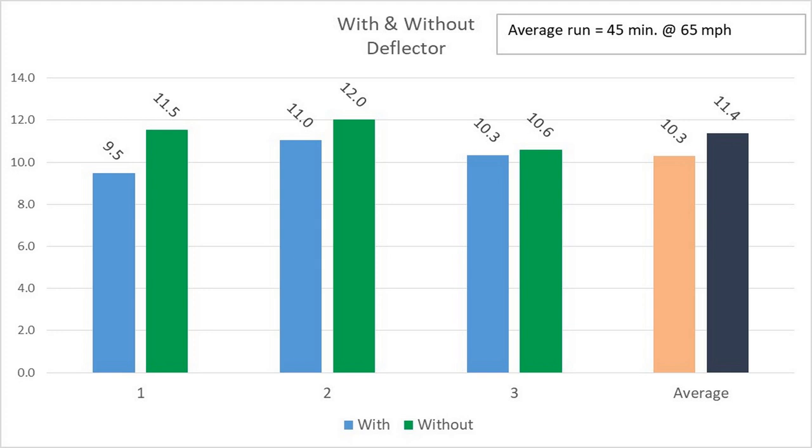I'm recording this data at 1 second intervals. So I pulled out all of the accelerating, decelerating, idling, anything that wasn't a steady 65 miles an hour, just to make sure that we are comparing apples with apples. Now, I've got my little black box recording 100% of the time while I'm running, so I looked at my overall mileage, which is a lot of 1 second intervals, and it was something like 7 or 8 miles per gallon, and that was mostly with this thing up, unfortunately. But that also included idling while I'm refueling and, you know, you name it.